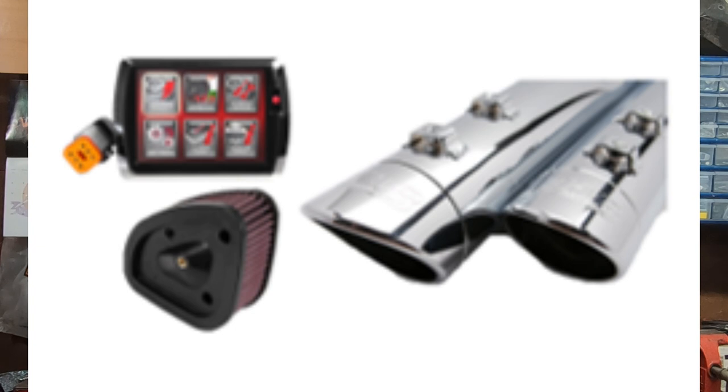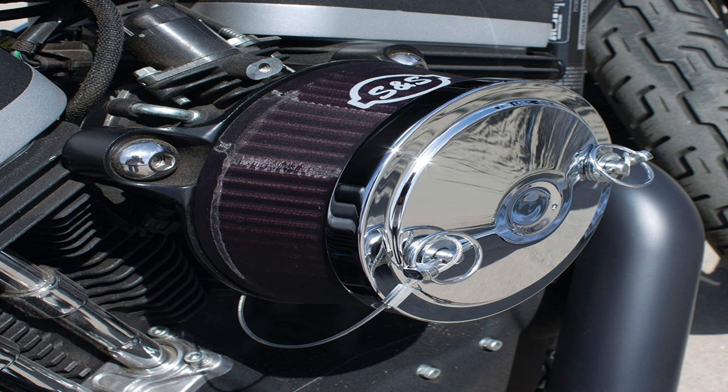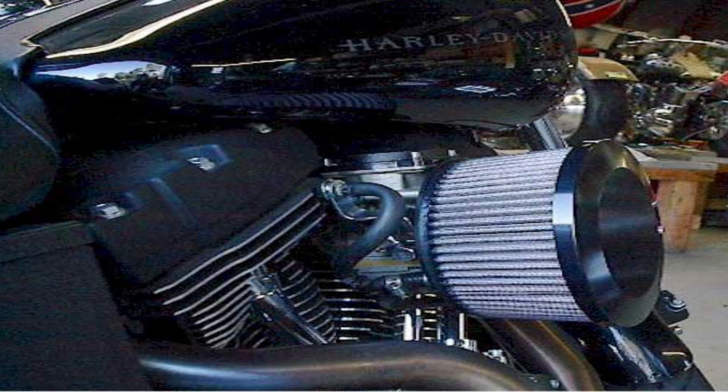Those bikes already aren't getting enough fuel, and at the same time they're not really getting the air they need, so they run like crap. Naturally the first thing you do when you get a stock Harley is put a set of exhaust on it, an air cleaner, and tune it — because none of that does any good unless you tune it. One of the worst things you could do is put a high flow air cleaner on without tuning. Your ECM is already compensating for the exhaust, and when you add more air it makes things really lean out — especially bad on carbureted bikes.